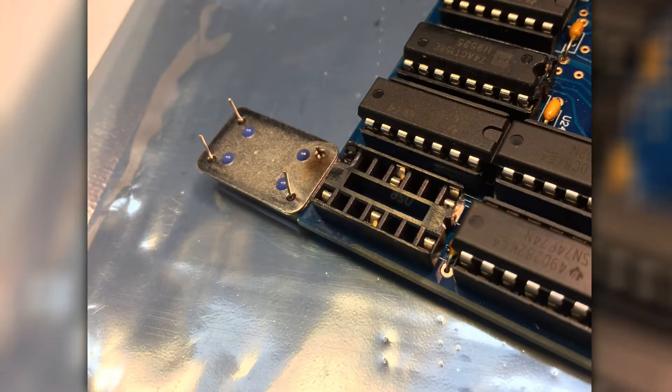Be careful when installing your card. I destroyed my test unit when the oscillator can shorted against my mouse card and I had to send it back to have it repaired. I tried several things to resolve the problems I was having, including reseating all the chips on the card, reseating all my cards, removing all my other cards, trying it in a different Apple, and using more than one diagnostic program. None of these things improved operation at 13MHz, including sending the unit back to Reactive Micro for evaluation.